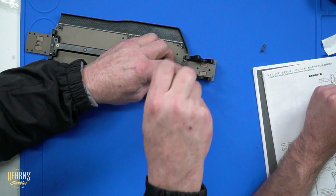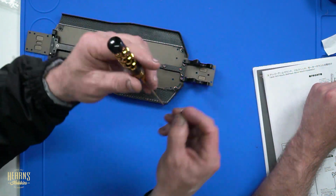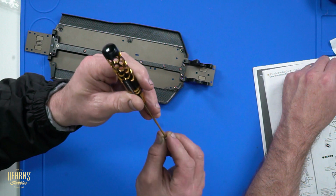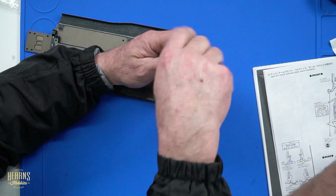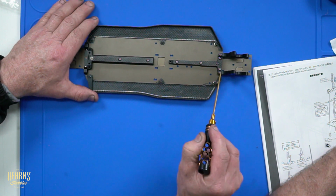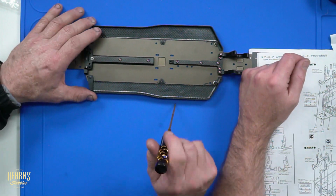It actually utilises the full capacity of the plastic brace. Otherwise, you just rip it straight out. In a big impact, you can pull the threads out of the plastic brace, then you've got chassis flex in the front end. And then you start doing all sorts of damage to the chassis itself, drivetrain, chassis, servo. And the car becomes all winky wonky. So just the two screws that go directly down in top of the two bulkheads into the plastic T-brace, 14mm rather than 12. I can feel the love that you're putting into this build already.